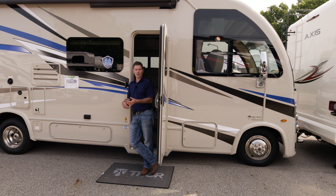We cannot stress enough the importance of maintaining your tires — so they wear evenly, give you better traction, and better fuel mileage. Check the tire pressure daily if you're going to do a lot of long drives. We do have valve stem extenders so you can check the inside tire. The last thing you want is the inside and outside tire at different inflation PSI — they could potentially rub together and you could end up in a bad situation. The proper PSI is printed on labels here. Check tires cold in the morning before you leave — don't check them hot after pulling into camp.